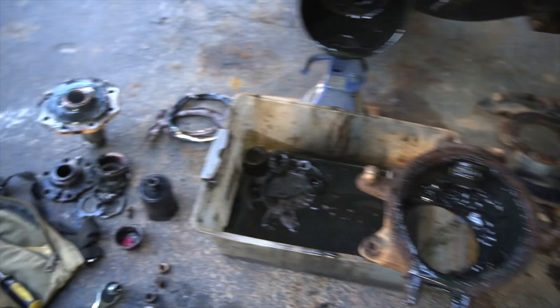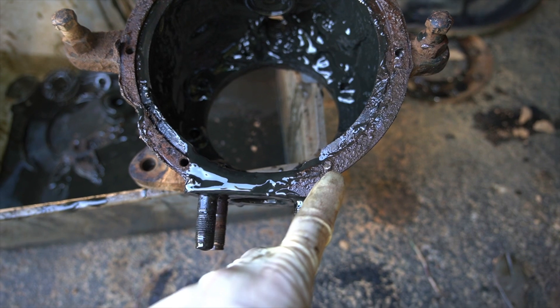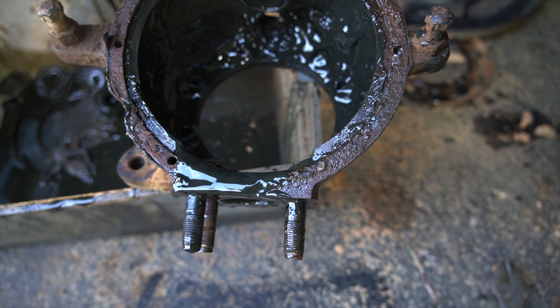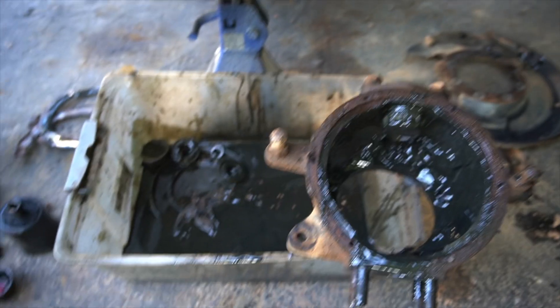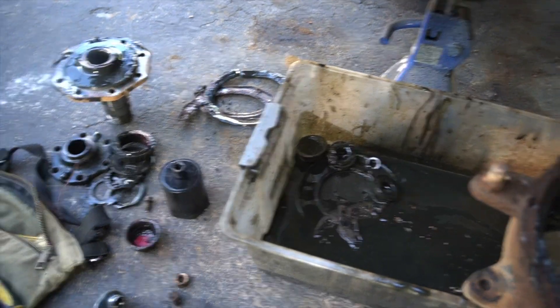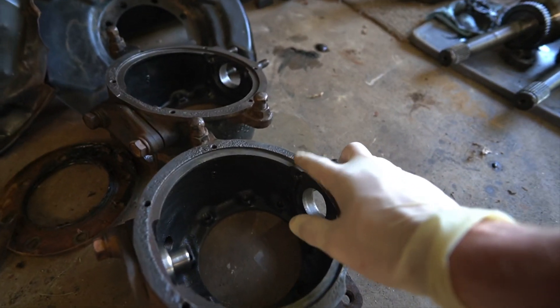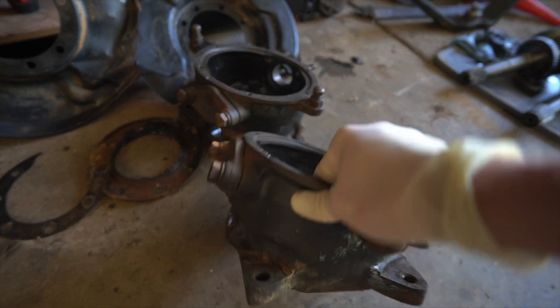Just going to give you a look at the mess we've made — whole pile of used paper towels. Did have one mishap on those 10mm bolts on the back — one of them had a mangled head and broke off as soon as I started backing it off. I'm going to have to either drill it out or get lucky and weld a nut to it. Now it's clean-up time — I'm going to clean the knuckle, the brake dust shield, and organize everything so I know where it goes when I put this back together. I did end up getting that bolt out — just had to weld a nut to it and the stud backed right out.